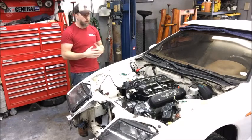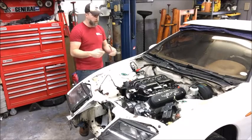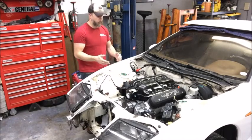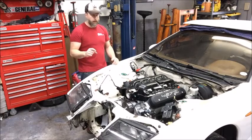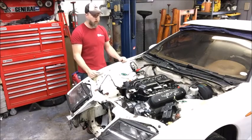This car is running stock LS7 EV6 short body injectors. Because the EV6 short body injector is so short, this intake manifold was designed to run a factory-style fuel rail with a crossover. That fuel rail is a very thin body, and it has bosses coming off the bottom that are standoffs to extend the height of the injectors.